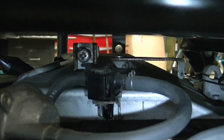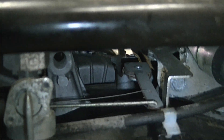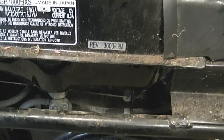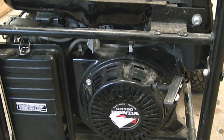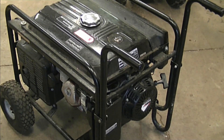The arm that the screw adjusts is attached to a spring — it goes to the rest of the linkage configuration and governor arm. Also, it's very important that you don't set the RPMs above what the manufacturer recommends. You could blow the engine, specifically the connecting rod, and you can damage your engine permanently. That's why I kept it just under 3600 RPMs, just to make sure it does not go over.